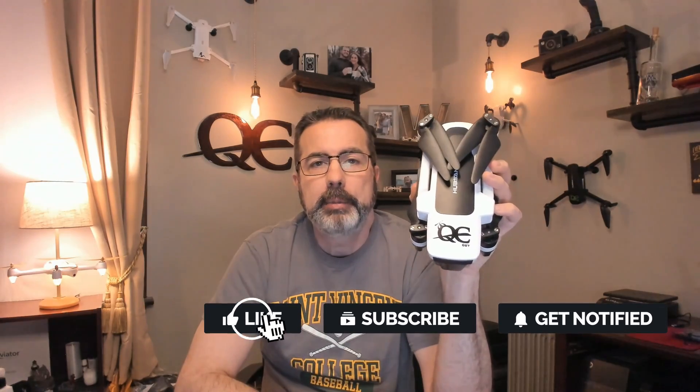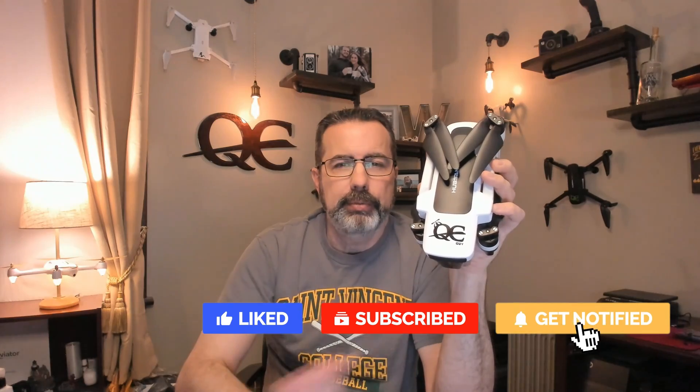Hey everybody, this is Chris. I've already got one video out where I've done a repair with the camera on replacing a ribbon cable, but I wanted to give you a quick reference one you can share with people having this problem. One problem people are starting to see a lot is the bad ribbon cable for the camera, where people have no FPV and then get that green and yellow flashing light on the side. A lot of people have no FPV right after doing an update and say they have a bad ribbon cable. I think the two are separate issues — a firmware update is not going to destroy your ribbon cable, that's going to cause a different problem.